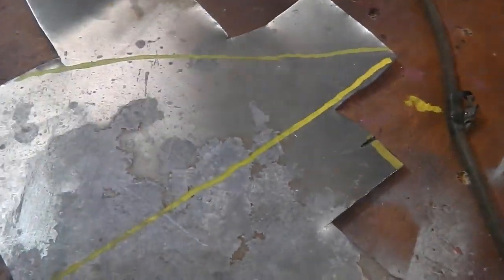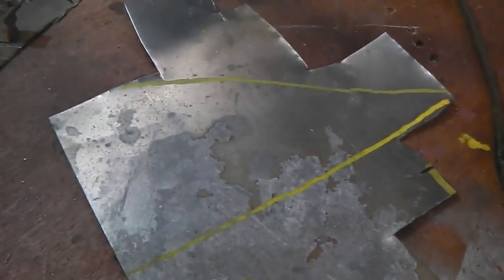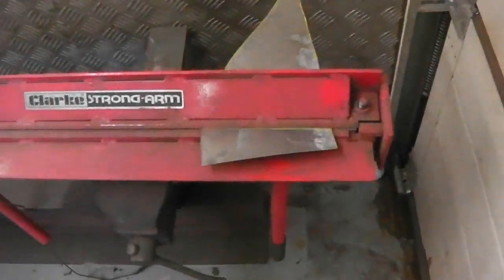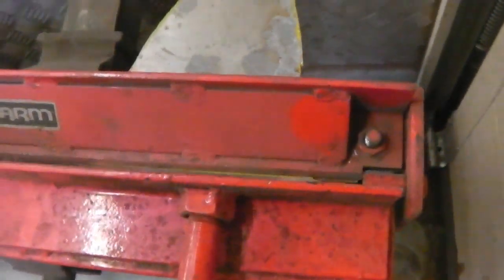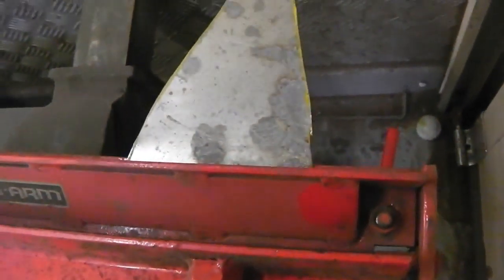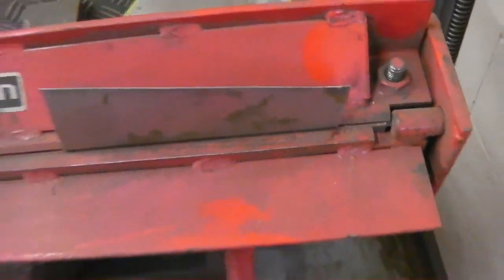That on top of there, it's flattened out, but we'll have to knock the curve shape into it. But it's pretty straightforward. Tin snips on, cut that out now. Okay, I'm going to use my panel folding machine to get a really sharp fold line on this. So up we go, locked into place, and then pull on the handle, and we'll get a nice edge on it like that. Let's go and offer that up.